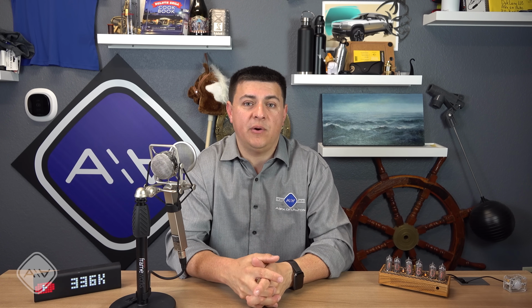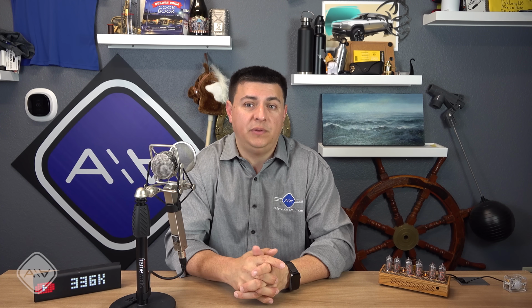Planetary power split systems like we find under the hood of Toyota's product line do require some modifications for plug-in hybrid use. So for instance, in the Prius Prime, we have some additional features inside that transmission case that allow both electric motors to drive the vehicle forward when in EV mode, something that we don't see in the regular hybrid models. But for the Honda hybrid system, all you have to do is provide a bigger battery pack and a bigger inverter because we already have that 181 horsepower electric motor. You just need to give that motor more power, and instantly you have a more powerful plug-in with a more powerful electric mode option.